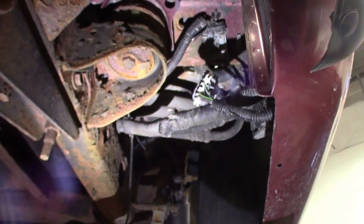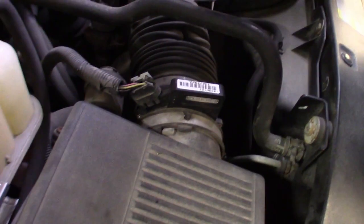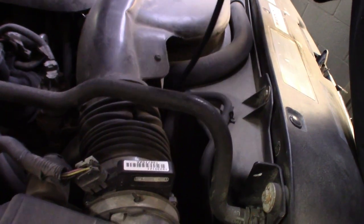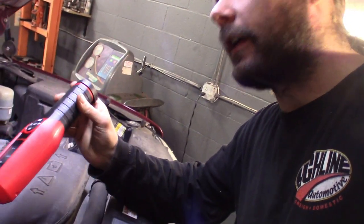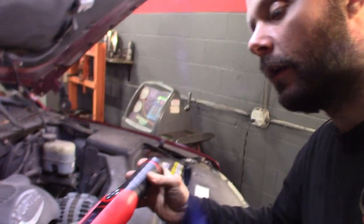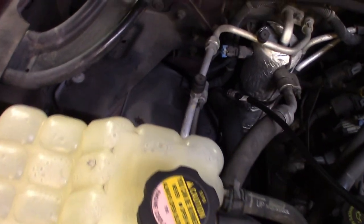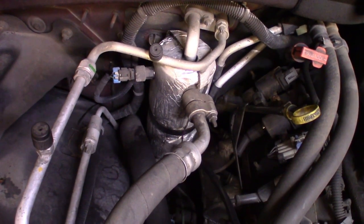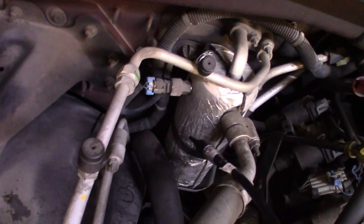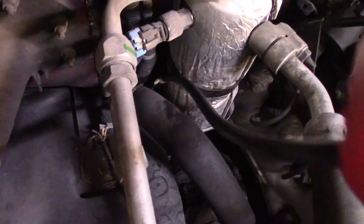No beep, so we're gonna go under the hood and check a few spots where I think it's leaking from. Up under the hood, I like to poke around — maybe at the top of the compressor here, see if we get anything. Follow the lines basically from the compressor to the condenser, all along trying to see if you see any green dye. I did fill this thing up — it's fully charged. Not hearing any leaks, not seeing any leaks, but we've got a full charge on it. The compressor turns on, but it's definitely got a leak. Just following the lines, see if we pick anything up. The bottom of the dryer sometimes likes to leak — inside these cases moisture stays in there and sometimes it'll rot it out. Not too often on these — mostly Ford's problem on the metal ones, not these aluminum ones. It's got the drain tube down there too — poke around there.